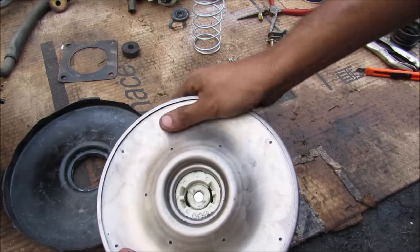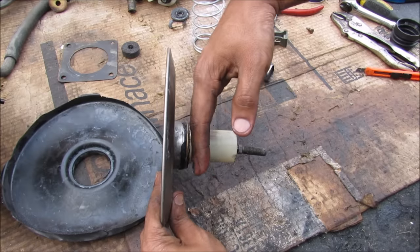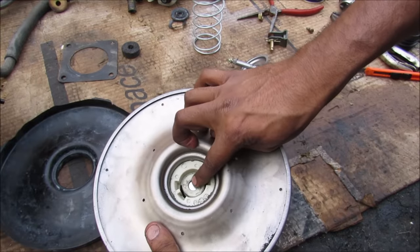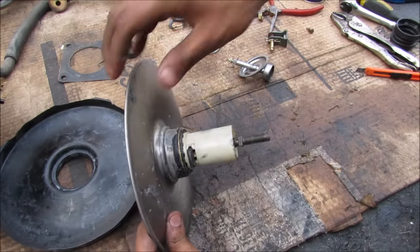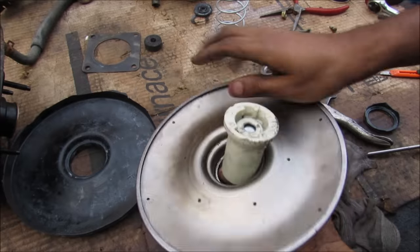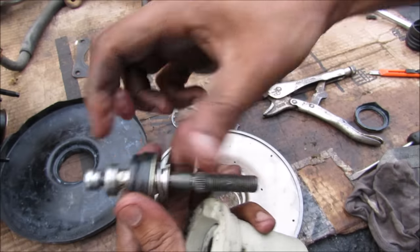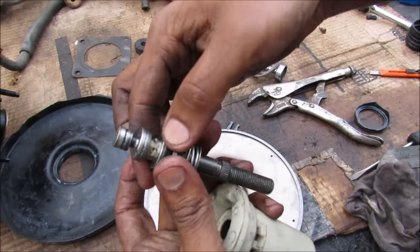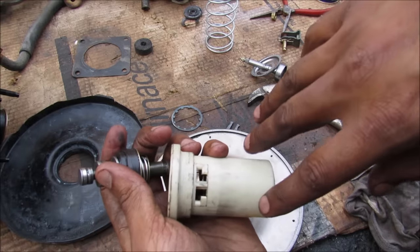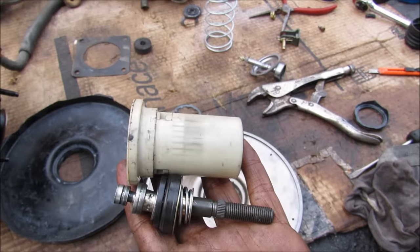There's a little valve on the inside that controls which side gets the vacuum. Normally you have vacuum from the engine on one side, but when the brake is not depressed you also have vacuum on the other side, creating equilibrium so the brake booster isn't pushing the brakes for you. When you step on the brake pedal it actuates the little valve, closing off the vacuum side and allowing atmospheric pressure to enter the other side, causing the pressure differential to push. The valve works with a stud connected to the brake pedal, a spring, and a rubber o-ring. Compressing the pedal squishes the spring, pressing the o-ring against the housing and sealing it off, building vacuum on one side while atmospheric pressure comes in on the other. When you release the brake, the spring brings back the stud and o-ring, allowing vacuum to build up on both sides and returning to equilibrium.